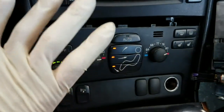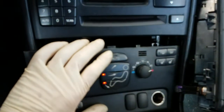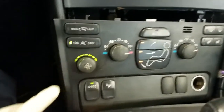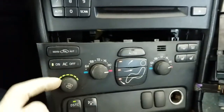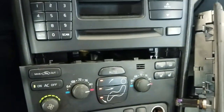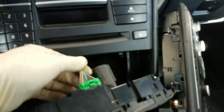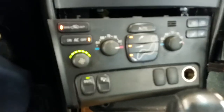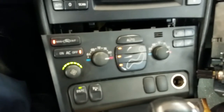Unfortunately this is the wrong HVAC control head for this Volvo, so we're going to have to find the right one — but we know for sure that's what fixed the issue. If you have a Volvo and your blower motor is cutting out with the same symptoms — really erratic operation, illuminations not lighting up — try tapping it to see if it cuts out. If that's the case, go after this control head. Also check the connections in the back to make sure you have a good tight connection. Hopefully this was helpful — be sure to hit the thumbs up and subscribe to the Flat Rate Mechanic. Till next time guys.